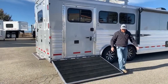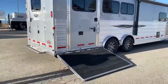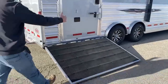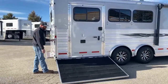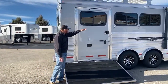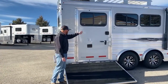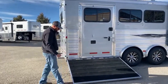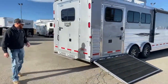Again, a nice big heavy-duty door — a lot of framing to it. Why does the ramp go past the door? The reason is, if you notice the way this ramp kind of starts at the front of the door and then works to the back of the trailer past it — you have to figure out that as horses are unloading, the natural angle as they come off this trailer, they're not going to make it 90 degrees and come straight down from the door. They're going to naturally come in this direction off this ramp. So when you extend it this way, it just allows them to come right off that ramp when they come to the back of the trailer.